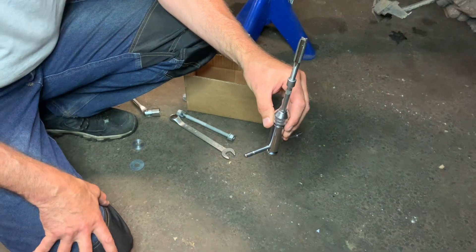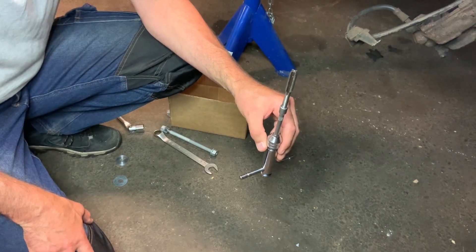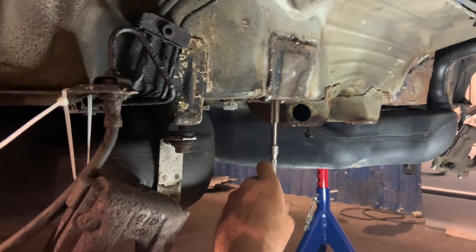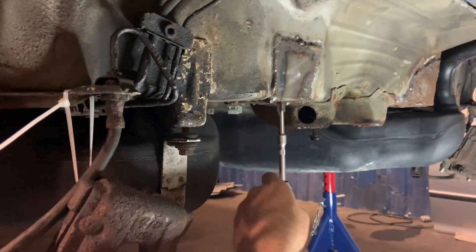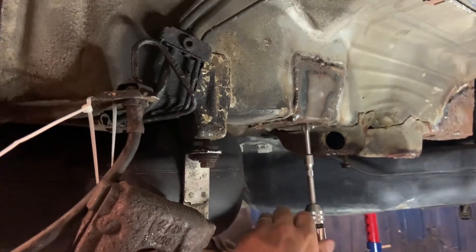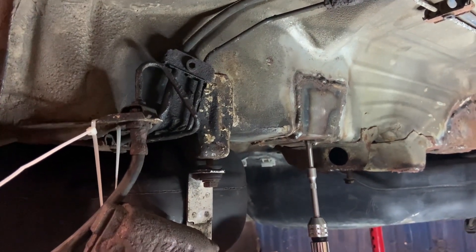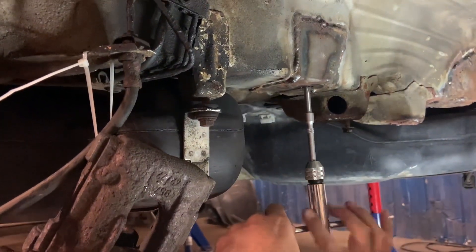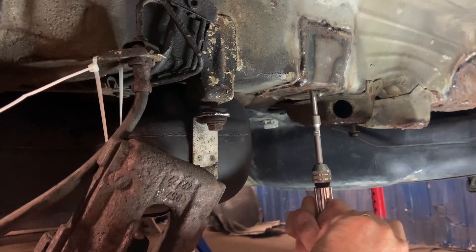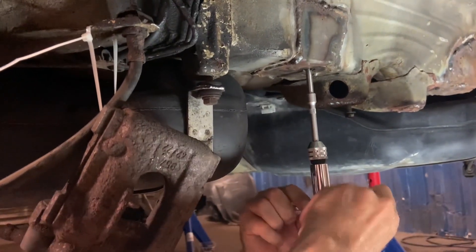What we're going to do now is run through the mount after we did the epoxy. Some of the epoxy has made its way into the threads — I just want to make sure that we clean that up. We're under the car. I'm running the threading tap up through, and I wanted to give you a couple of tips. When you're threading this — the first thread — you will be threading through and at the beginning there's really not much resistance. When you get to the point where you're starting to actually cut thread, what you want to do is run it maybe one turn, then reverse it slightly. You will feel a click when you do that. Then run it another turn just to clear the threads — you'll get a nicer thread if you do this.